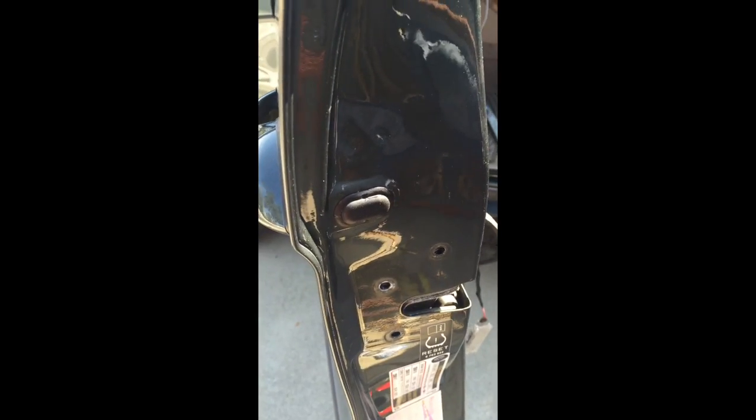We're going to remove this plug here because the actuator is not dropping out — it's obviously attached to the lock in some way. We started working on the outside edge of this plastic plug, but it absolutely wouldn't budge. Then we discovered that it's actually just the inner part that comes out.